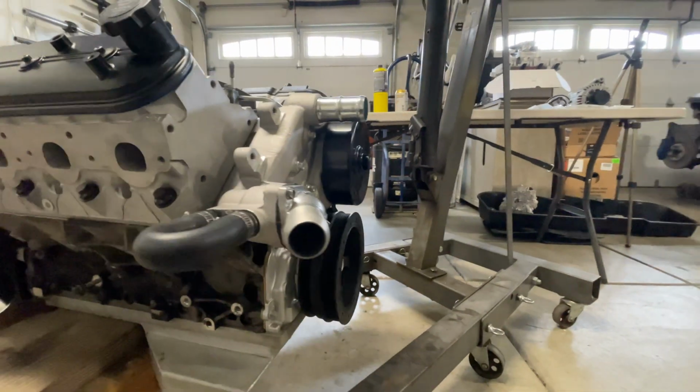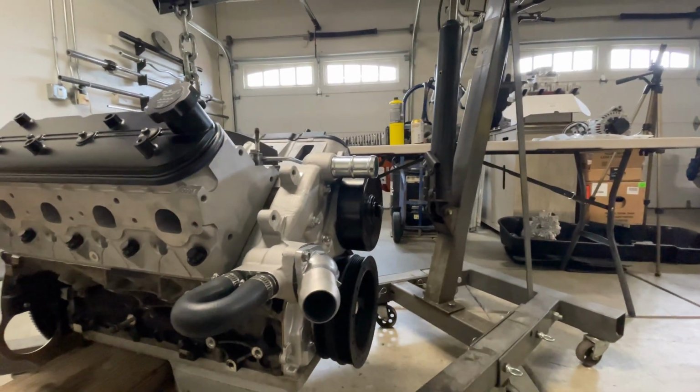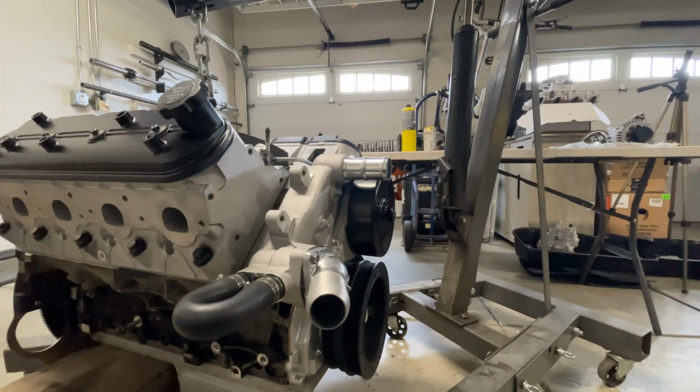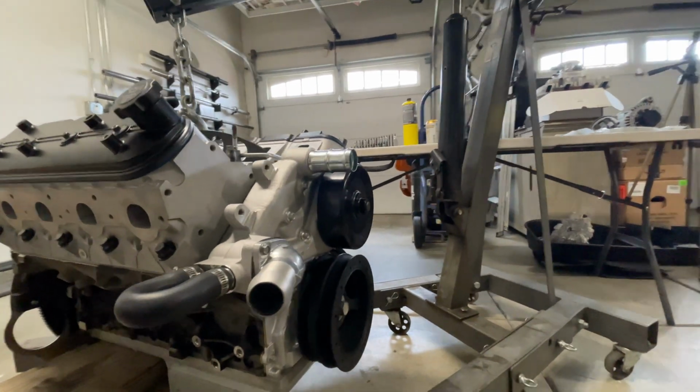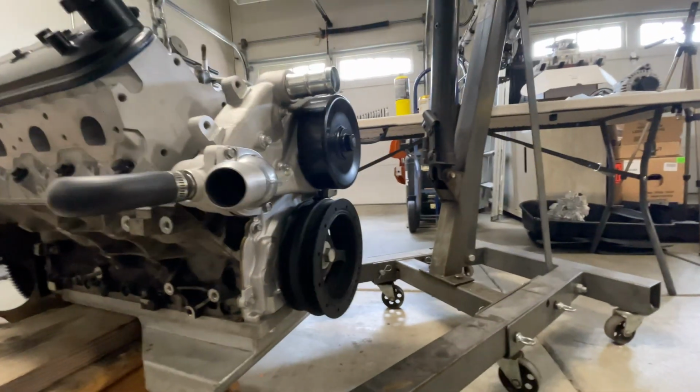So here's my water pump, and you can see where that pulley is in relation to the engine. That's what I'm talking about. Same with the crank pulley, how it sits pretty close up against the front of the engine. 3 types. And Corvette, CTSV, they're the same thing. That's gonna be your slimmest. It's gonna put all the accessories closest to the front of the engine. The next step is gonna be your Camaro, GTO, Firebird, anything in that family. That's gonna be your middle ground.